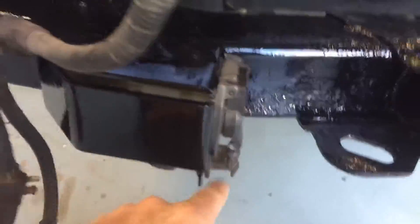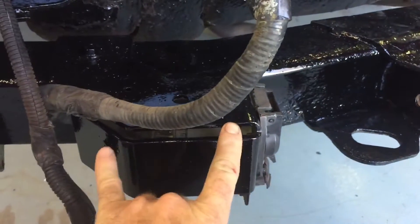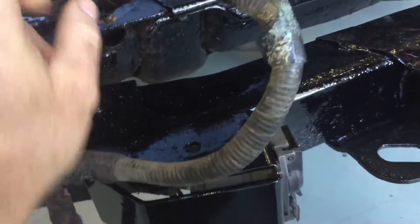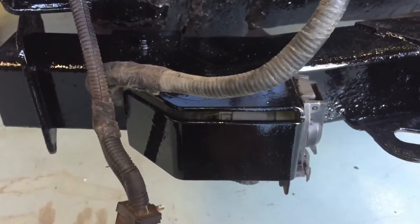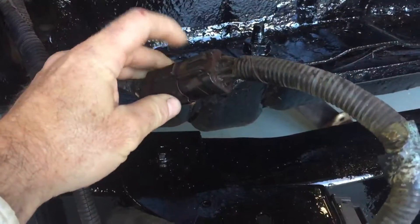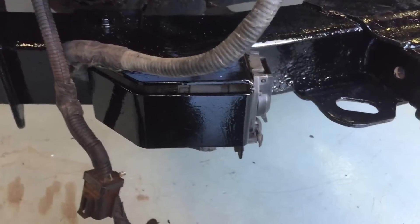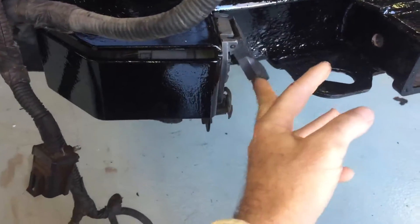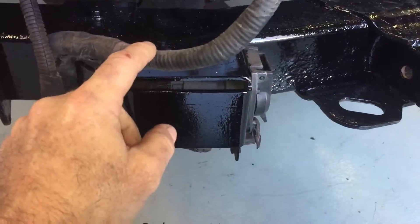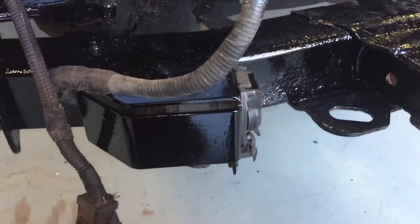There were problems every now and then and they do hook up a four prong flat, so we're going to go ahead and get a new whole assembly — we'll buy the whole thing. There's no use cutting and splicing when you can buy the plug. We don't need the seven prong adapter, but we can get the wire that has the four prong flat attached, and then reuse the seven pin box.